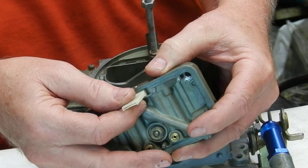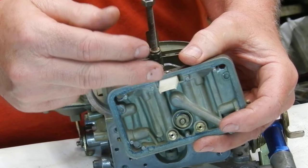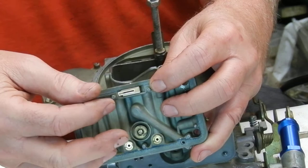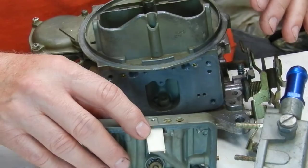There are several ways we can do this. We put a vent — these come in some Hollies, some of them don't. Quick Fuel sells them; that's just a press-in and the gasket holds it in. It's a very good little vent, a little shorter, but you just want it where when the fuel sloshes back up it doesn't try to go into the vent hole and drop into the carburetor. QFT — Quick Fuel Technology — has a great little vent that just pushes in, and then the gasket just pushes on and holds it.